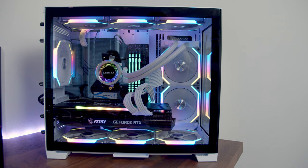We've got a radiator on the side set to exhaust rather than intake, which is going to give us worse temperatures. If you bring cool air in from outside the case through the radiator, it gives you better cooling potential than taking hot air from inside the case and pushing it through the same radiator. The reason I did this — which I covered in my full build guide — was this was just a starting point, building what I thought was the best-looking PC in that orientation purely for aesthetics, fully aware that temperatures were likely to suffer. So how much were they likely to suffer? That's what we were going to find out.